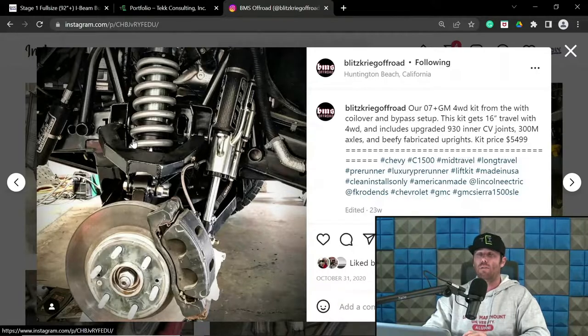Maybe not. If you're at 92 inches wide and you have 18 inches of usable wheel travel in your long travel setup, you're fine. Don't even stress it. You do not need to push any more. If you cannot drive that truck properly with 18 inches of wheel travel, you've got much bigger issues. You need to learn how to drive that thing with a little bit more of a skill set orientation,